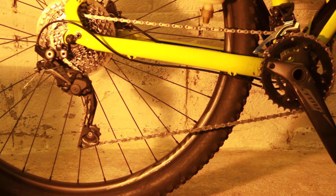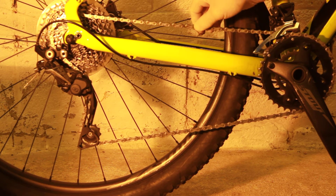If you apply it to the outside of the chain, then you're applying it to areas where it's not even touching any of the working parts. Applying it to the outside will really only attract dust and dirt, and it will make your chain wear a lot quicker.